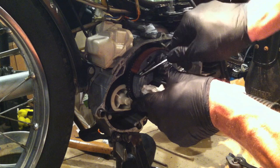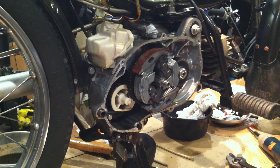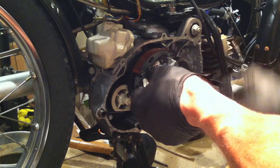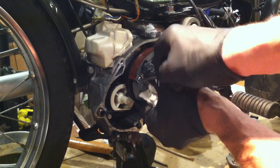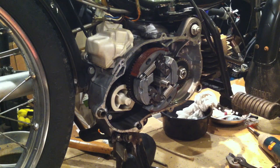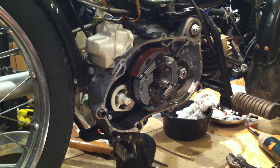These stock ones are really wimpy. I also have black clutch springs which I debated putting on — they are pretty stiff, the stiffest of all — so I stuck with these orange ones. And we're in, folks. That amazingly easy swap will make a tremendous difference in your performance. That looks good, this one looks good, that one looks good — that looks marvelous. Didn't even take the clutch off the bike.